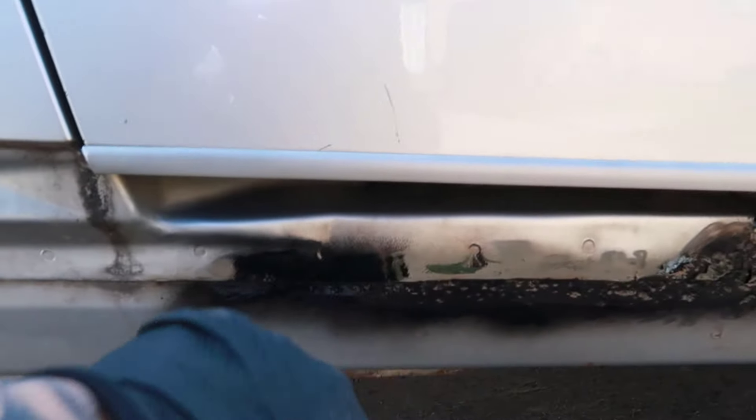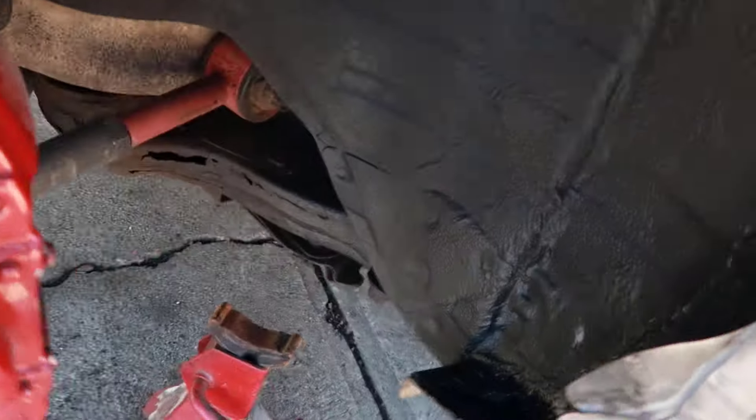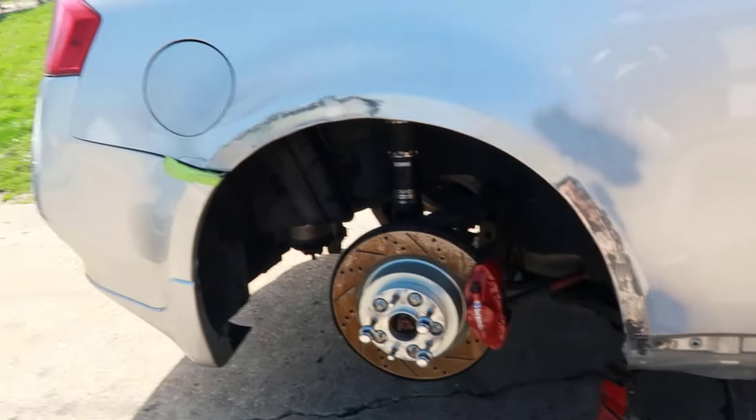So I got this down to the bare metal again. And then I took the side skirt out — I had a lot of rust spots here, so I'm grinding it down. And then I'm putting some of this rust barrier on there. Figured I'm already doing this, so I might as well take care of as much as I can. I put some of that all over here, and I just gotta wait for it to dry and then move on to the fun stuff.